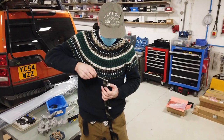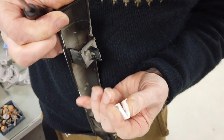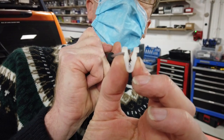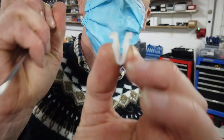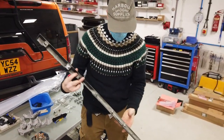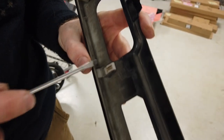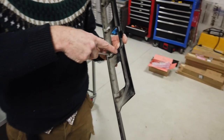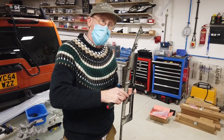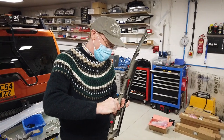You're going to have to get a little screwdriver just in there and that should just ease those off, because it's got those little clips that grip on the inside. You've got to just spread them. We'll get all those clips off — they're just like the same but little baby versions, they're really cute. We know these clips — Tyler's got history with these fender clips, they're the ones you drop down the drain.